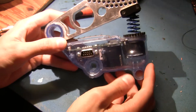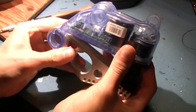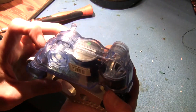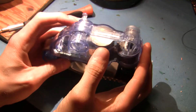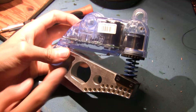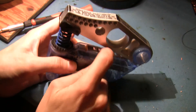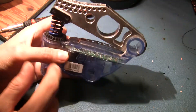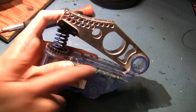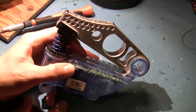On the positive side, we have something interesting to tear apart, and you can already see there's a lot of electronics here. There's a huge capacitor — very beefy — rated 7,000 microfarads at 200 volts, so there's quite a charge there and we'll have to safely discharge it. There's a spring, a hinge, and some electrical contacts down here — just a copper strip with a bunch of fingers. This thing would be compressed against the body before it's triggered and needs some way to make contact.